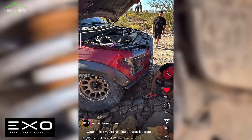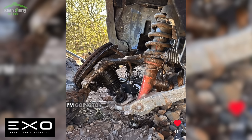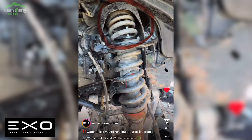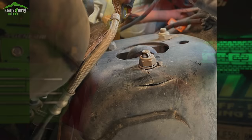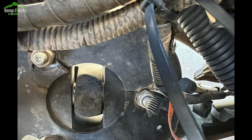When the rivets fail, the suspension is allowed to droop too much, causing the upper and lower ball joints to fail, leading to catastrophic failure on the trails — and it can be very dangerous when those ball joints fail because the whole suspension just collapses. A less common failure is cracking through the shock bucket from the constant extra load, with the bump zone completely eliminated. All that load is sent up without any extra dampening, causing the shock bucket to start cracking, and in worst-case scenarios the shock can break through.